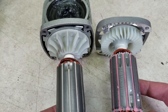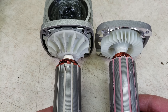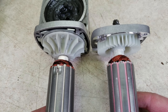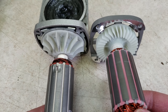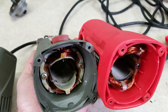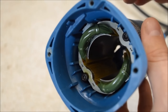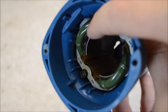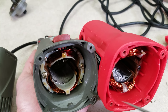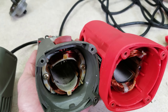The new one does have a better fan — it's a directional fan versus the non-directional fan on the old one. Since these polishers only spin one direction, it makes sense to have a directional fan that can more efficiently move air. Neither of these have epoxy reinforcement on the field windings, which is something we've seen on nicer tools in the past, but on both of these everything is tightly wound and secured, so nothing's loose and vibrating and risking breaking.